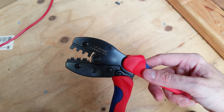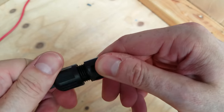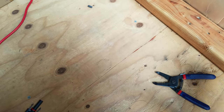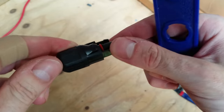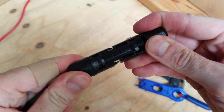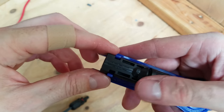I'll leave a link in the description if you're interested in purchasing this tool. Once that's done, you slide on the nut, slide into the fitting until it clicks, then tighten down the nut — you want no space in between, because tightening compresses a rubber grommet to form a watertight seal. If you have trouble getting it tight, there's a tool that comes with the crimper you can use as leverage. The nice thing about this tool is you also get the disconnect part — you put it over the tabs and pull it apart. No more sitting with long nose pliers trying to squeeze tabs and yank at the same time — I destroyed too many connectors that way.